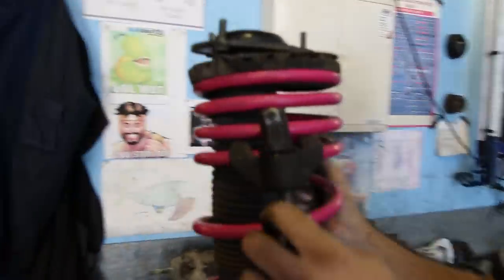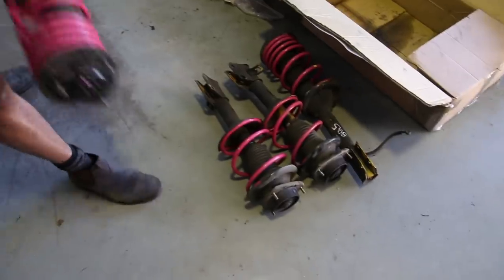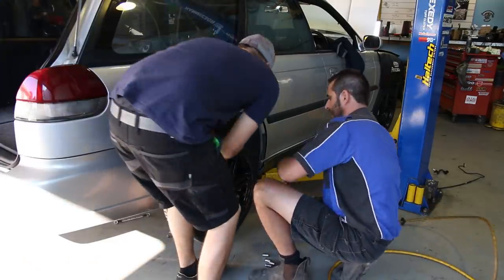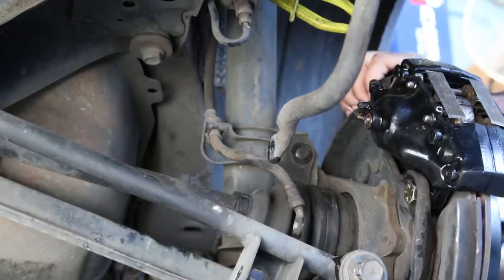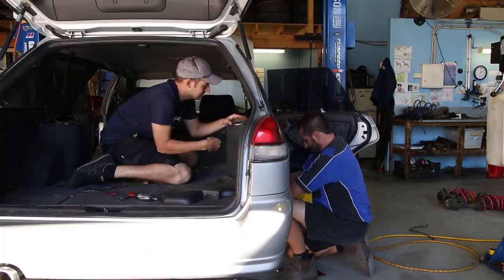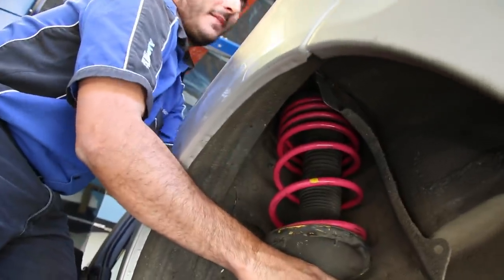It's kind of weird that Subaru make all their stuff pink. It's a little bit strange - why didn't they pick strange green or blue or something? Maybe all the other colours are already taken by aftermarket performance houses. The springs are compressed and then placed onto the shock. The strut tops can then be bolted back on and the spring compressors undone. The old suspension needs to come out, so the wheels are coming off and the rear struts released from their prison. We also need to remove the brake line as the mounting bracket for the brake line is different - many people skip this step and end up with cable ties holding their brake lines on. We can then swap out the front struts using the same method.